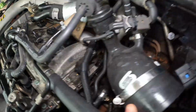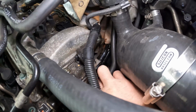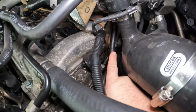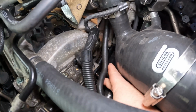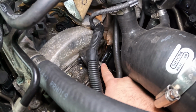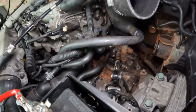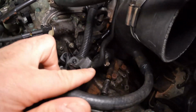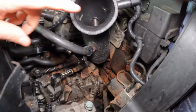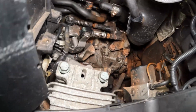Have a quick look at your heater matrix pipes, which are the two. It's a lot easier to see when you're not filming. See these two here, and they go up into this heat-proof, protective stuff here. So just check there. There's some joints where they come across here. I'll put a diagram up so you can see a bit better what goes where and what pipes what, so if you do diagnose it you know what to look for. But like I said, it's definitely easier with the airbox or your cone filter off or whatever.